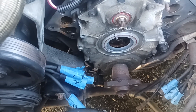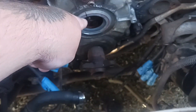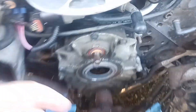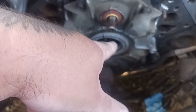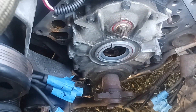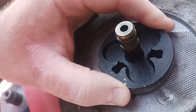How could the timing be off if it only goes on one way? I can tell you right now that is not true. That little tab coming off the cam can and will fit in any of the three holes. It was supposed to line up with the square/rectangle hole, but it was about 180 degrees off. When I first did this, I didn't replace either of the two seals because they didn't look like they were leaking, but this time I figured that was a sign I should replace them. The old optispark — maybe from having it in the wrong hole — was completely bent to one side, and the rotor wouldn't spin at all; it was 100% locked up.